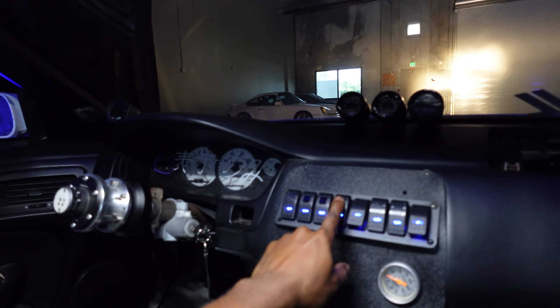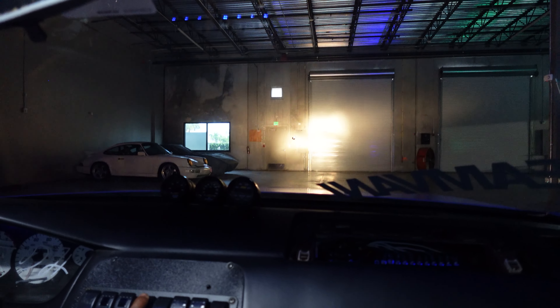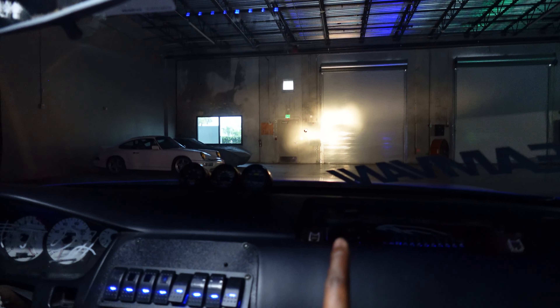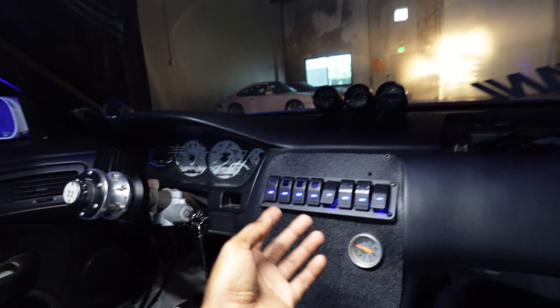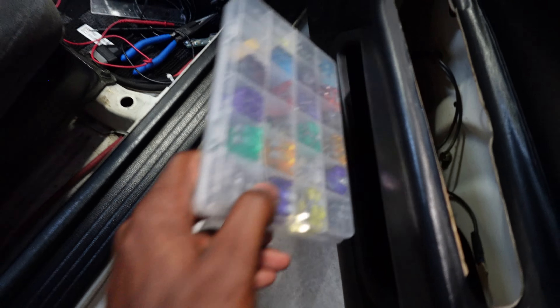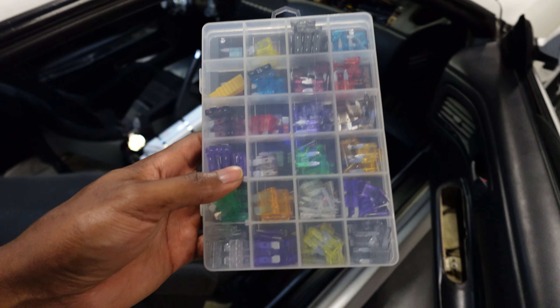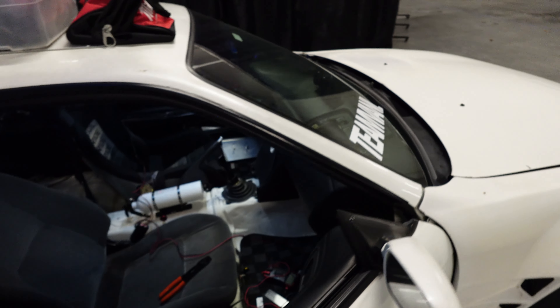When I hit this one, which is going to be for the wipers, it's going to fill in the rest of the headlights. We're going to disconnect those headlights, and this is also activating the wiper harness — it's just not in use right now. The wiper motor is a 20-amp circuit and our harness has a 10-amp in it, so I'm going to change out that 10-amp fuse on the fusing relay panel for a 20-amp.